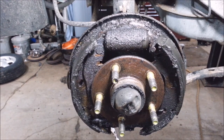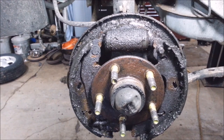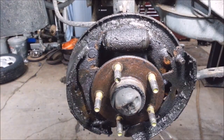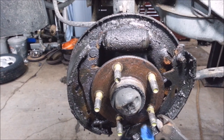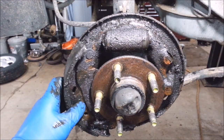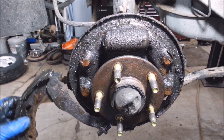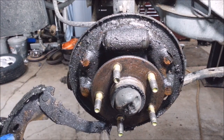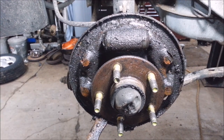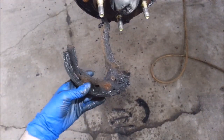I can always make those work. I'm going to need a screwdriver too — just going to get under here and pull these out, the little hanger thingies. Get that spring out of there. Now for this, I'm going to try not to get this cable off — this cable's got to stay on here. Don't pry on it too much because it'll come off and then you get to put it back on, and sometimes they're not fun. I got to get this clip off of here.